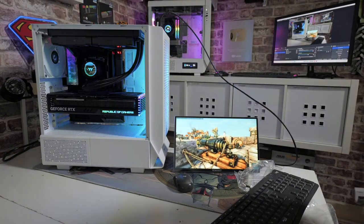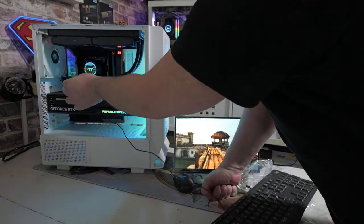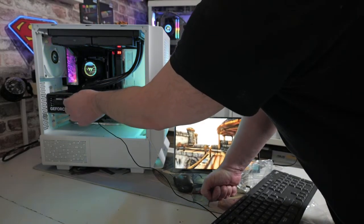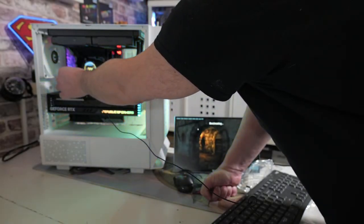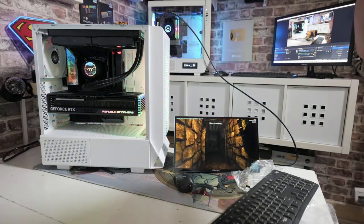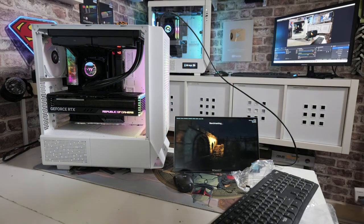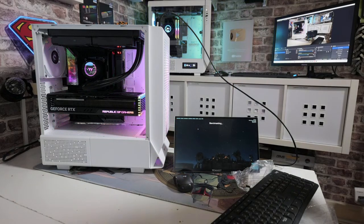I will put the microphone near the graphics card, so you can hear. How is the sound with the panel on, and the temps? Can it run Minecraft? It might. Definitely coil whine, because it changes pitch. Yeah, I think if it was running 1440p or 4K, it would be fine because it wouldn't have those ridiculously high frame rates.